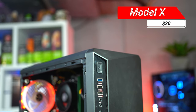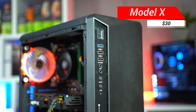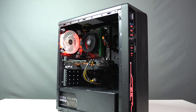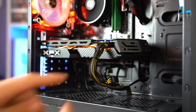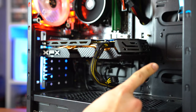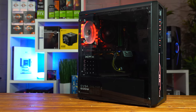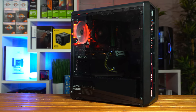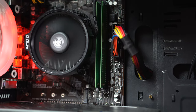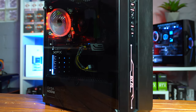Finally we have the case, and I went with this DIY PC Model X, which isn't even sold new anymore. The only reason I picked this one up is because I had it laying around the studio, but I would just recommend any case around $30. Do be sure the case you select can physically fit a beefy GPU if you're going with the RX 580 that I did. I'd honestly recommend getting a dark tinted side panel like this one to hide the ugly decisions we made earlier — I'm not a fan of these ketchup and mustard cables or the ugly green RAM.